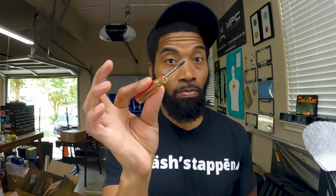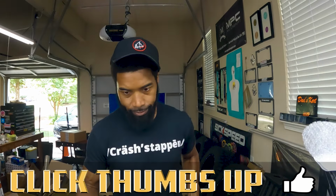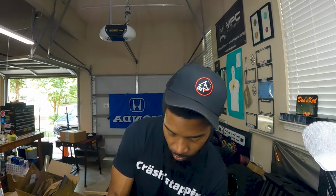With this first one, I hate to say it, the best thing is probably a small metal screwdriver. I don't like using metal on plastic because usually plastic's going to lose that battle and you could break these clips. And we all know clips on cars and trucks that are plastic, when we use metal, typically end up breaking, especially if the car's a bit older. So sometimes what you would like to use is a plastic tool, where are they? A new toolbox. I'm still getting adjusted to my new toolbox, but it should be in here somewhere.